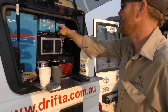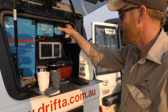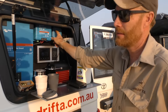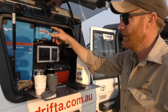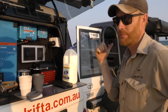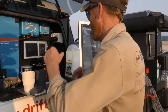The app is a big thing. Also with this system, the solar controller is separate to the DC-DC and both run in conjunction. While you're driving you're pumping 30 amps into your batteries, and at the same time anything from the roof solar is coming in as well — an extra 3 to 4 amps on top of the 30. On the roof of the trailer I've got 525 watts, so I can be pumping 30 amps into the trailer and 25 amps in from the trailer solar simultaneously. You can see everything on your phone.